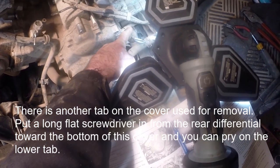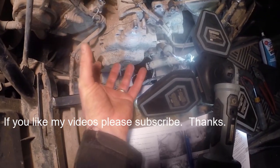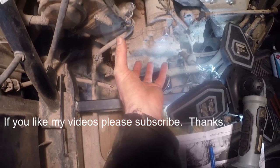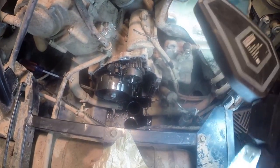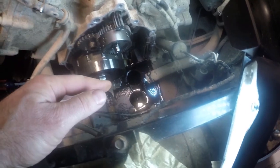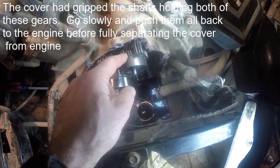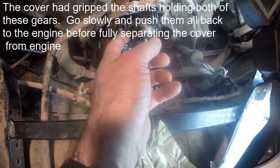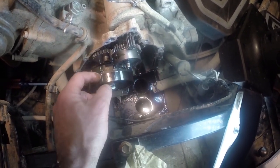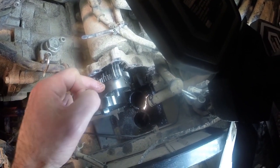The way we're going to avoid removing the oil filler pipe is by taking this wire harness and moving it under the pipe before the cover comes off. It is a magnetic rotor that grips on the stator through magnetic force, so even if this is completely freed up it's going to feel like it's seized. I pried from the bottom and tapped from the top - and the cover came free. What I could see was this gear migrating forward with the case. As soon as I could get the case far enough out that I could get a screwdriver in, I used it to push this gear back.